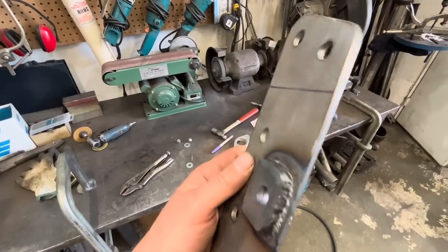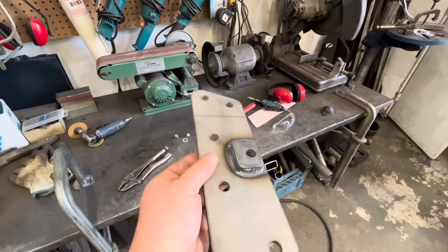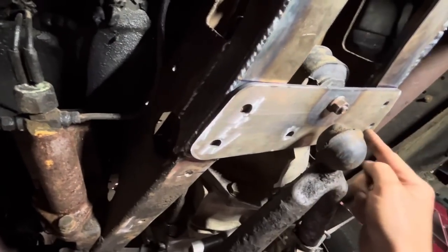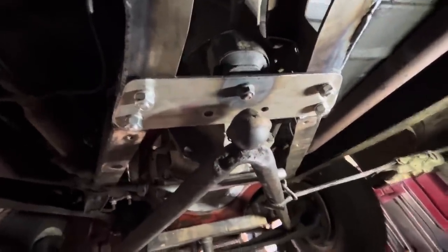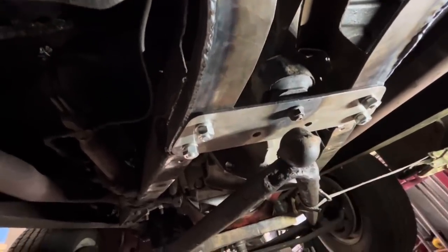I've got a spacer on there now, so let's go fit this, maybe drill the holes and mount it to the X member, and then we can work on the wishbones. Yeah, that worked out pretty well. Happy with that. So I'll just run some drill bit through here, put some 4 bolts in, and I think we're good. Got 4 holes drilled in there, thanks to that amazing $9 Princess Auto step bit. Some 7/16 bolts to match this one. So now we can build our wishbone mount.